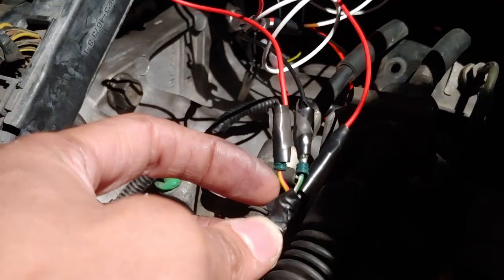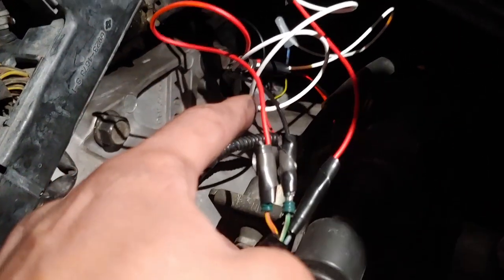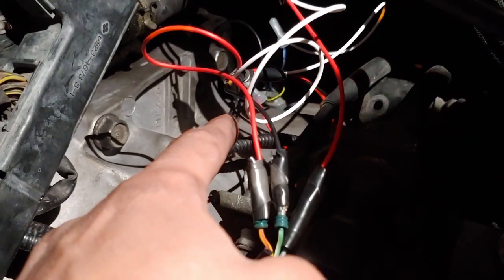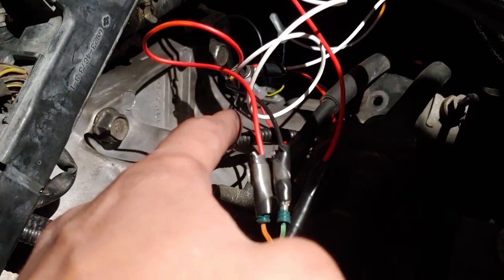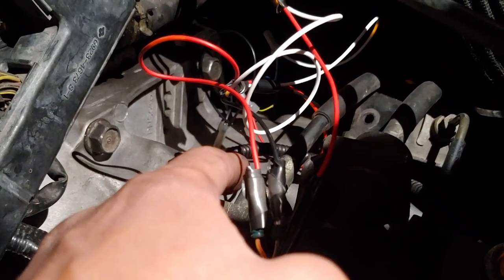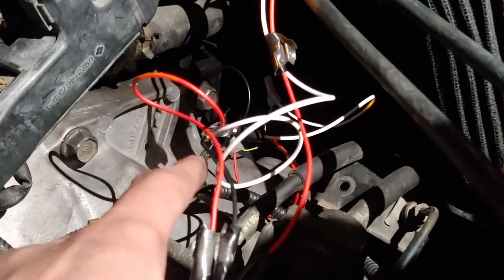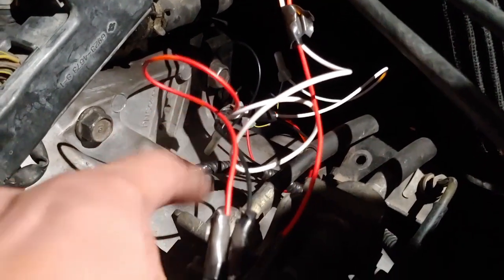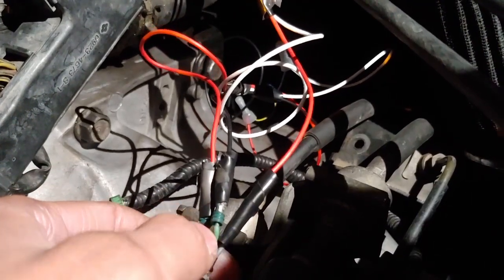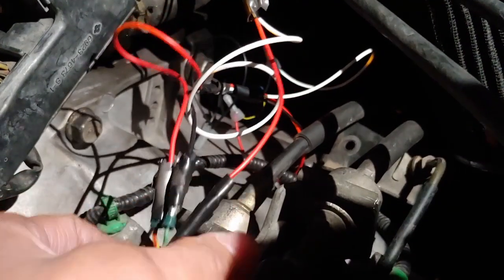I used the yellow-red and tied it to a new pigtail — a 2002–2004 pigtail. He actually got it from a 1992 EG Civic at the junkyard, and it fits the speed sensor connection on the 2002–2004 RSX. The yellow-black on the 0204 harness feeds to the yellow-red, the green-white is the ground on the 0204 harness, and the solid blue on the 0506 corresponds to the blue-white on the 0204.